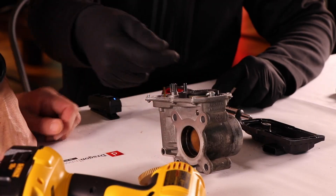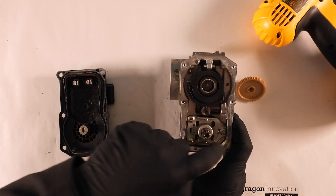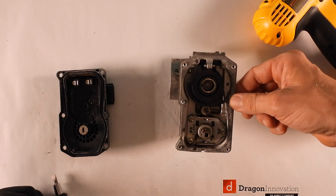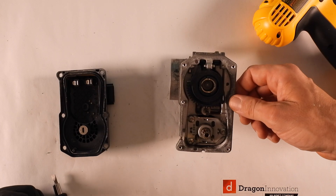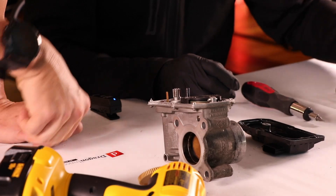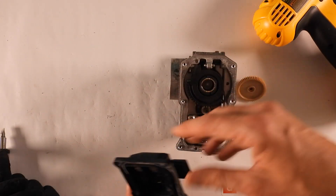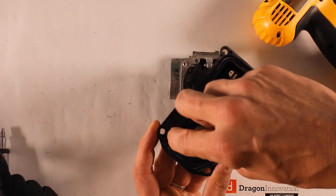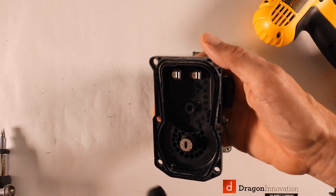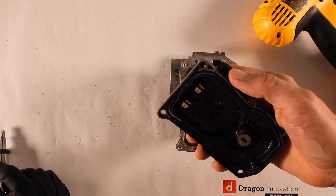So you're machining here, and also machining in this direction, and here — but you're not machining to put screws where the rivets are. So maybe they did it to save cost; they didn't have to tap it — it could definitely have been done, they were in the right axis. You said the thing broke and it appeared to be sealed. As we look in here, we see what appears to be a gland, but there's room for a seal and no seal. Maybe that's your problem.